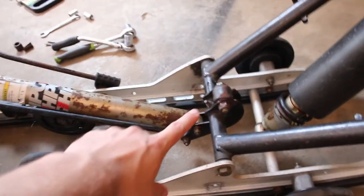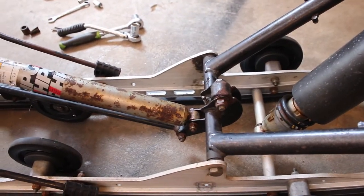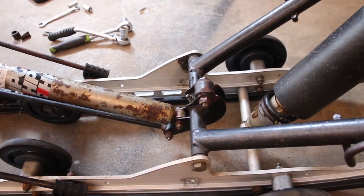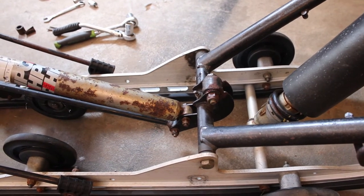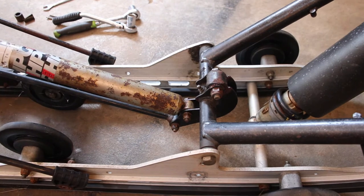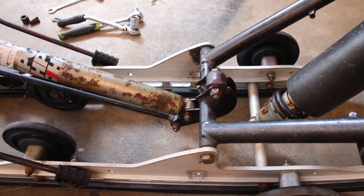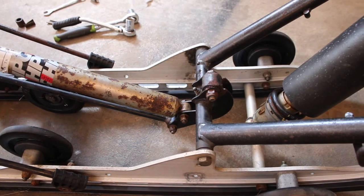You just watched me make a new bushing for this upper mount here. The one that was in there was pretty well shot — I'm not sure what material they are, might be some kind of poly — but I made one out of metal, so it's really more of a spacer than a bushing, but it'll work for now. I'm going to go ahead and grease this thing up and then we'll get our brackets mounted and get this tucked up underneath the sled.